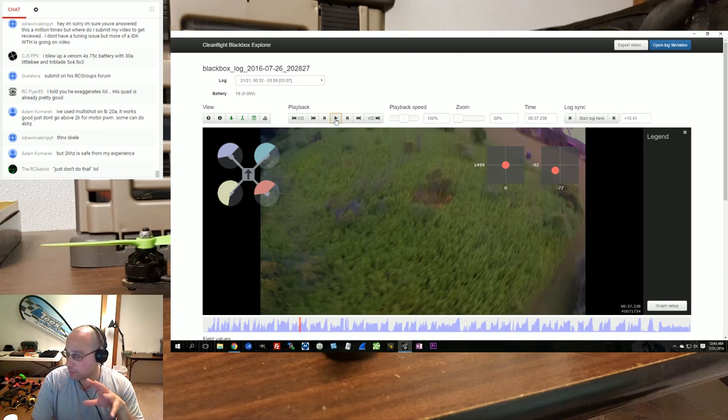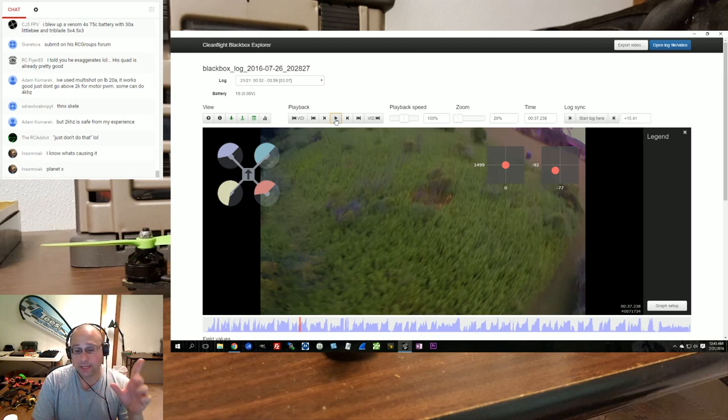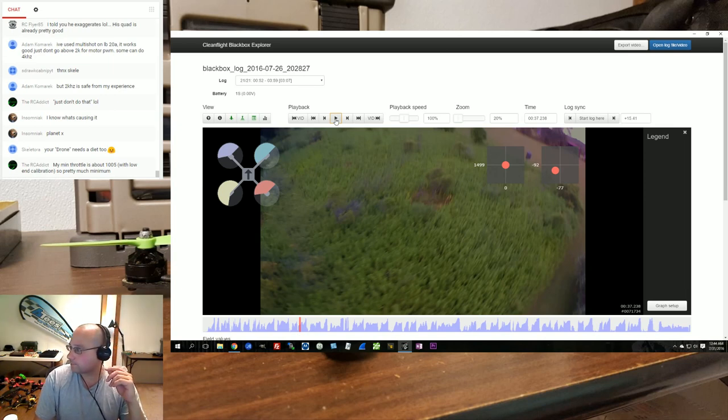But you're at a point where there are no choices you can make that will not have trade-offs, except maybe going to multi-shot, except you might smoke your ESCs. But I think if you stay at 2 kilohertz, you'll be okay. So that's what I would say. Everything else you do with your tune is going to have some trade-off, and I feel like the copter right here is flying very well with almost no prop wash. I don't think there are any easy answers here. So there you go. All right.